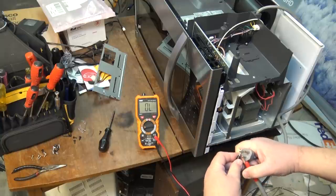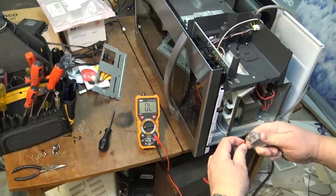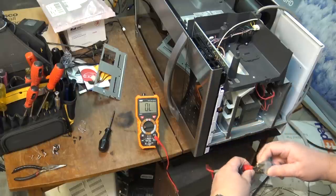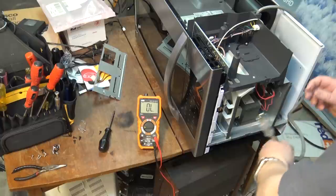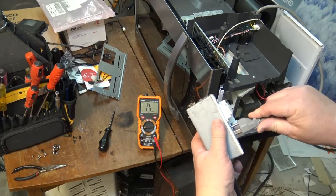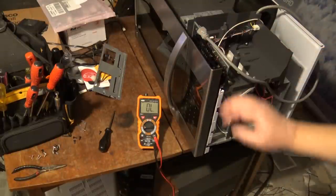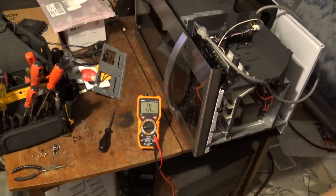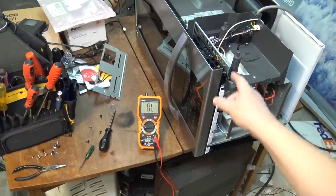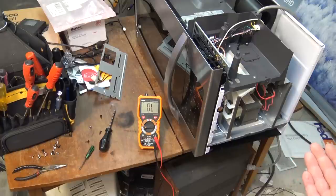What's interesting is there's no dead short — when I measure between the pins of the cord there's no short, yet when I plug the power in it immediately blew the breaker. The fuse is not blowing because this uses a 20 amp fuse, not a 15 amp, and my circuit breaker is 15 amps. There's obviously a problem, but there's no short until there's power applied.